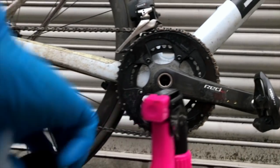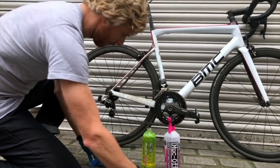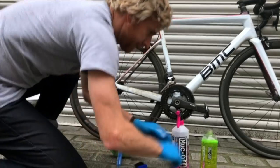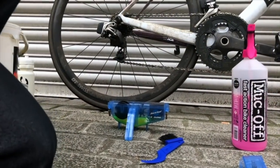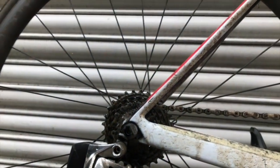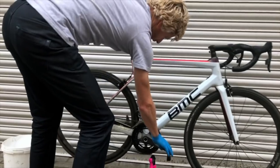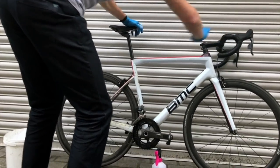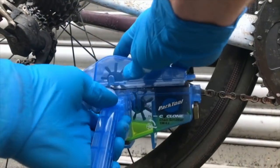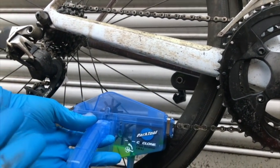While he's doing that, I'm just going to pop some degreaser in the chain bath. I need to do this fast because it's freezing out here and I'm wearing a t-shirt. So you just set the desired amount of degreaser in the chain cleaner — simple as that. I would make sure the chain's in the middle of the cassette for this bit. I'd also put it in the small chainring, so I'm just going to pop that down. The chain bath goes on the chain in this position here — the top just simply clips into place, like so. That's the position you're looking at to start.